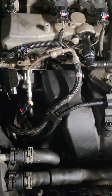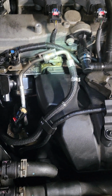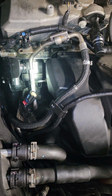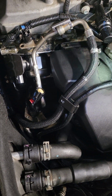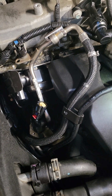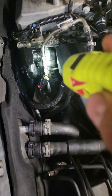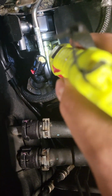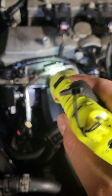It is a high pressure fuel pump. And there's your lines. Okay, if you ever have to take that off, there's videos on it, but you do not have to do what I actually only saw one video. This kid took his manifold off and everything. If you already have your cowling and stuff off, and I'll get to that, you can easily take this off. All you have to do is unscrew the top line. You don't even have to disconnect from here.